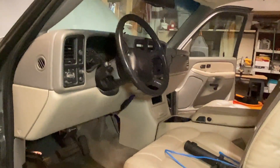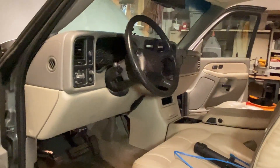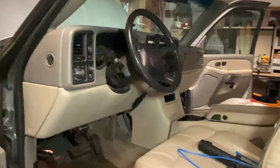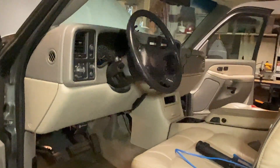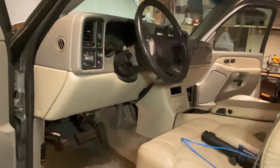Although the procedure we're about to do is very, very simple, I urge you not to undertake this if you question your ability to understand electrical circuits. It is very simple, but if you don't do one particular thing, you can have problems. On the driver side, down under here, there's a fuse box right by your parking brake — that black box is what we're going to take the cover off of. And up here in the engine bay, we've got the fused junction block. These are the two places we're going to work. We're not going to take any dash apart.